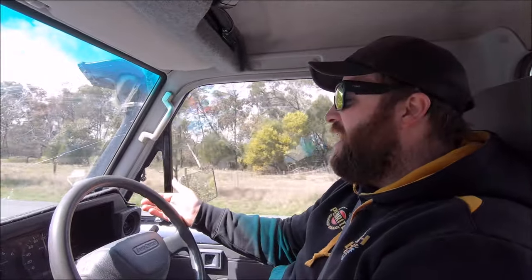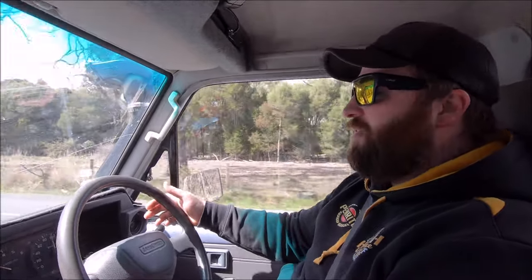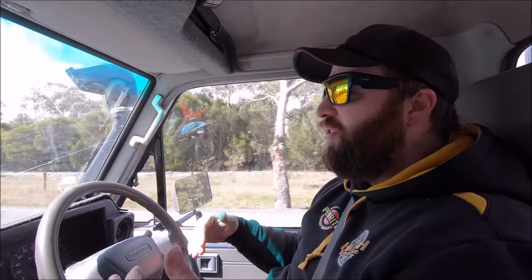And we're going to watch the two gauges, the Redarc one and the eBay one. This is the only gripe I've got with the Redarc gauge: it doesn't show fine increments like this eBay one does. The eBay one shows 286 degrees now, and the Redarc one is showing about 375. But the Redarc one goes up in increments of 25 degrees, whereas the eBay one goes up in increments of 1, so it's not 100% accurate. The biggest gap I've seen so far between the two gauges is 150 degrees, but we haven't gone up any real big hills and really put the ute under load, but that's what we're going to do. So we'll stop flapping our gums and show you some temperatures.